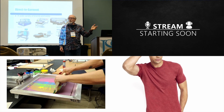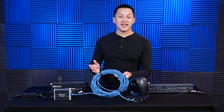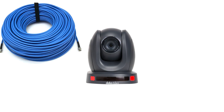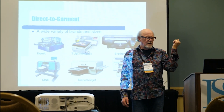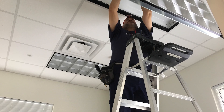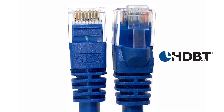You can use a setup like this with a video switcher, a camera controller, and a laptop to capture a presentation at a conference. It's easy with one cable because it's a lightweight cat 6 cable, versus a traditional camera setup which would require an SDI cable, a cat 5 cable, and an AC power cable. You wouldn't need to run a long power cable or find local power near the speaker. Some venues may require getting an electrician with standard AC cables, but not with HDBase-T — because after all, it's just Ethernet cable.